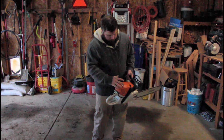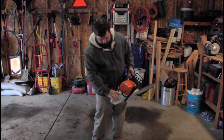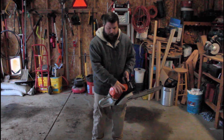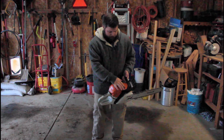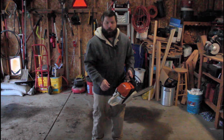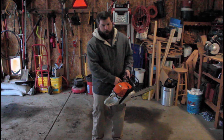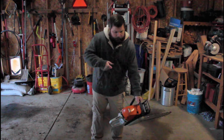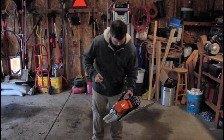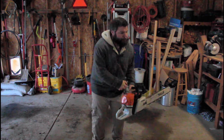So it's already warm, I already did that. You squeeze the trigger and the safety switch, push the switch all the way down to choke, push in the compression thing here that just kind of opens up, makes it easier to pull. Once you hear it try to run on its own, you want to take it off choke. Just click it up into the high idle. Like I said, probably could do that right now, but we're going to go through it. All I do is just drop it. And I flooded it. It didn't need to be choked.